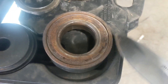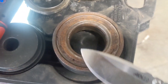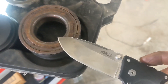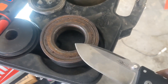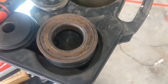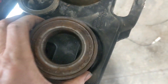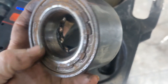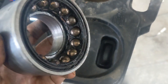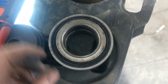The back side of the bearing actually has a magnetic surface to it. I've got the new bearing in the freezer before I press it back in, but my knife sticks pretty aggressively to the new bearing and hardly at all to this old one. The bearing wasn't growling, but I'm wondering if over time — with heat, this car has about 150,000 miles on it — the magnetic force of this bearing has just worn enough.